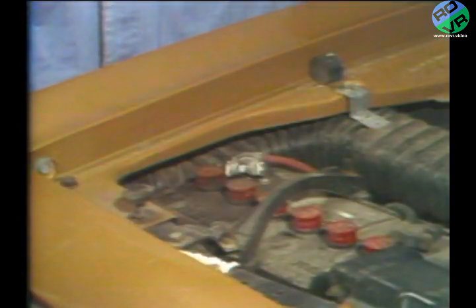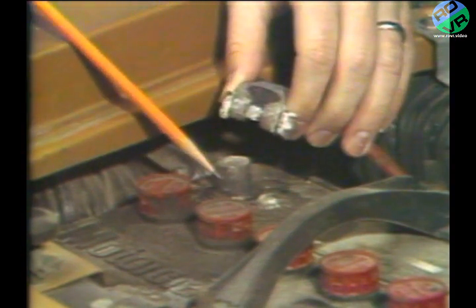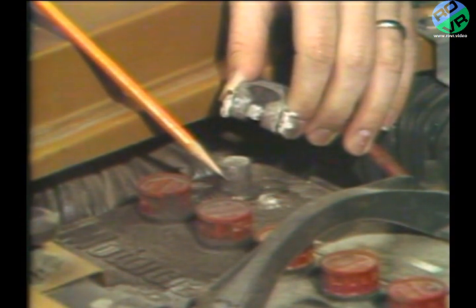The most common cause of misdiagnosis is the failure to detect loose or unclean battery terminal connections, even when the connections seem tight and clean. This gray oxide can interfere with electrical continuity. Once you are convinced that problems do exist in the vehicle's electrical power supply system, and they are more than surface problems, you are ready to start your troubleshooting.